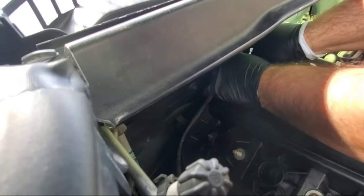Now you can see the before and after — the whole surface area is clean where the gasket is going to lay. Take some brake cleaner, spray it around and wipe as you go. You can also spray it on the microfiber cloth and wipe the surface that way. Clean around the gasket areas where the spark plug holes are. Now I'm going to show you how to remove the gasket from the valve cover.